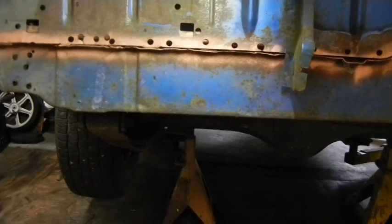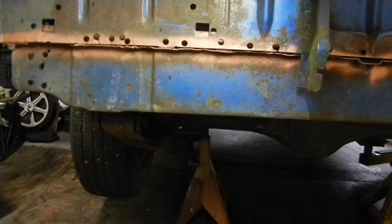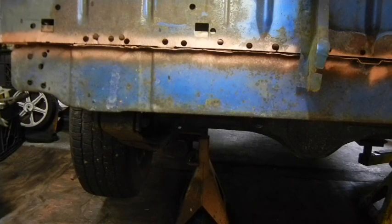As you can see, the gap has closed significantly. Now I can start tacking it all up and welding it in. It's all screwed down with the self-tappers in all the critical areas — all up in the front up there, all through here to the back member there.